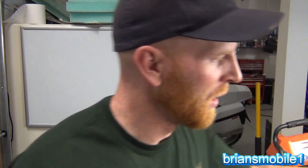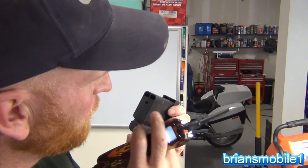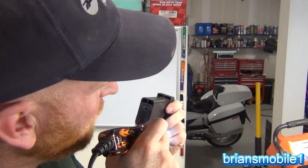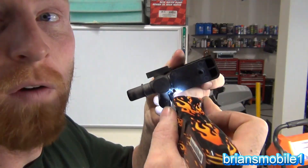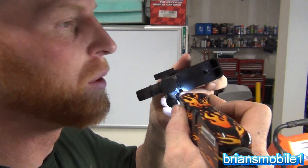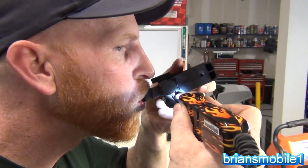Here's what the bad one does. Point it to the ground, put your ground on the bottom one because that's where the ground lives. Positive goes here. So far so good — it's still venting like it's supposed to. Problem is, it doesn't close. So now you know how to test it. You know where it is — go for it.